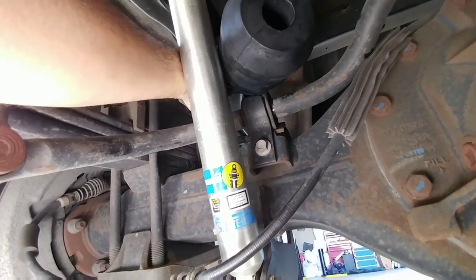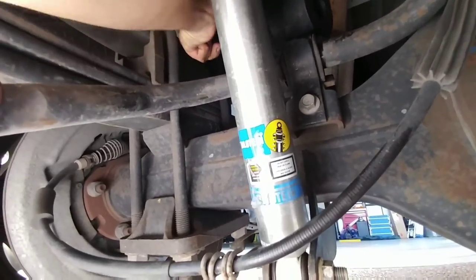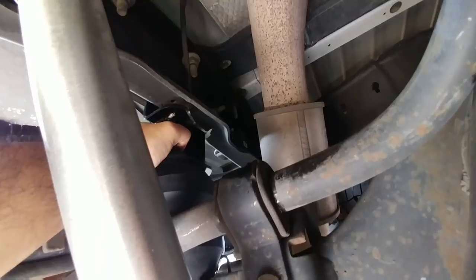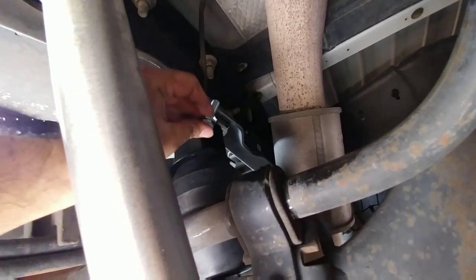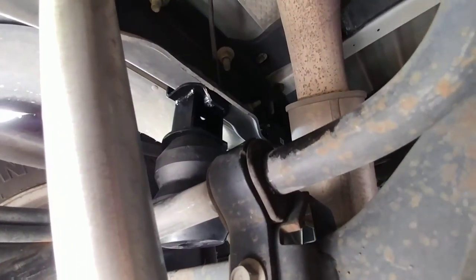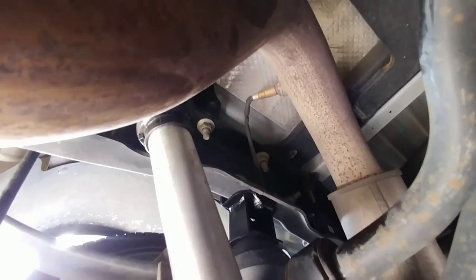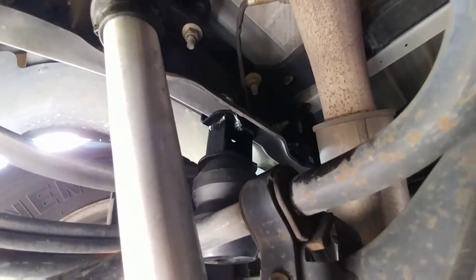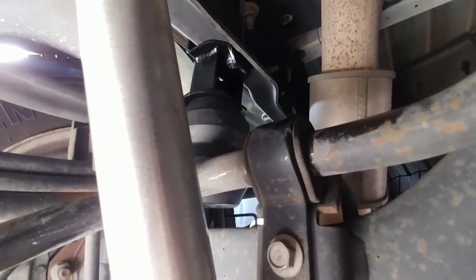Because the rear shock is on this side of the axle, you have to worm it up and around like this, get it as flat as you can over the axle, and then prop it up. Then I'm going to thread the bolt and washer through, put the nut on top, and tighten it down. Just finished tightening the second one. A little safety tip: be sure your exhaust isn't too hot. I waited until mine cooled down, but it's still a little bit warm, so you might make contact with it. Just want to avoid burning yourself. This one's mounted, same amount of clearance between it and the top of the axle housing.